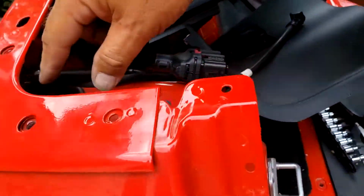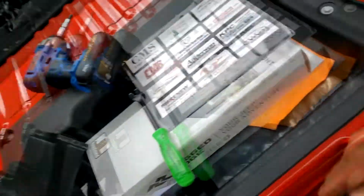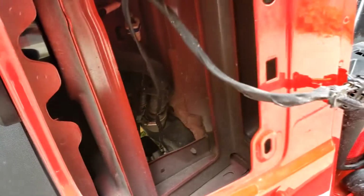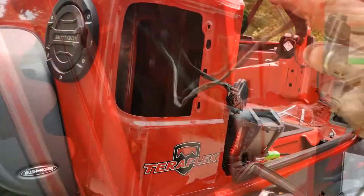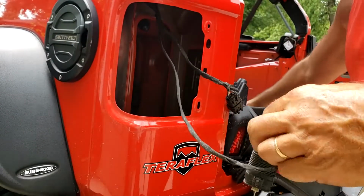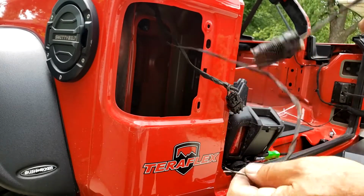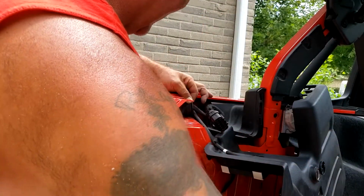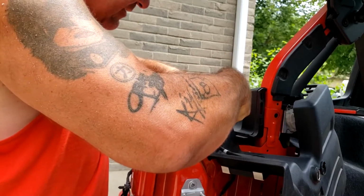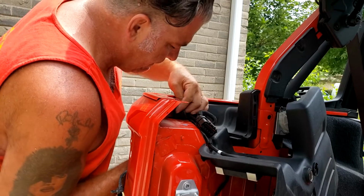So we're gonna hook up to that wire there, run it down here, across here, and into the new wiring. The best way to access your license plate light is by removing the brake light. You're not gonna be able to get this fitting through the grommet, so I suggest just snipping it off. Next, we'll take the grommet and we'll just place a little slice in there so we can get this wire to it.